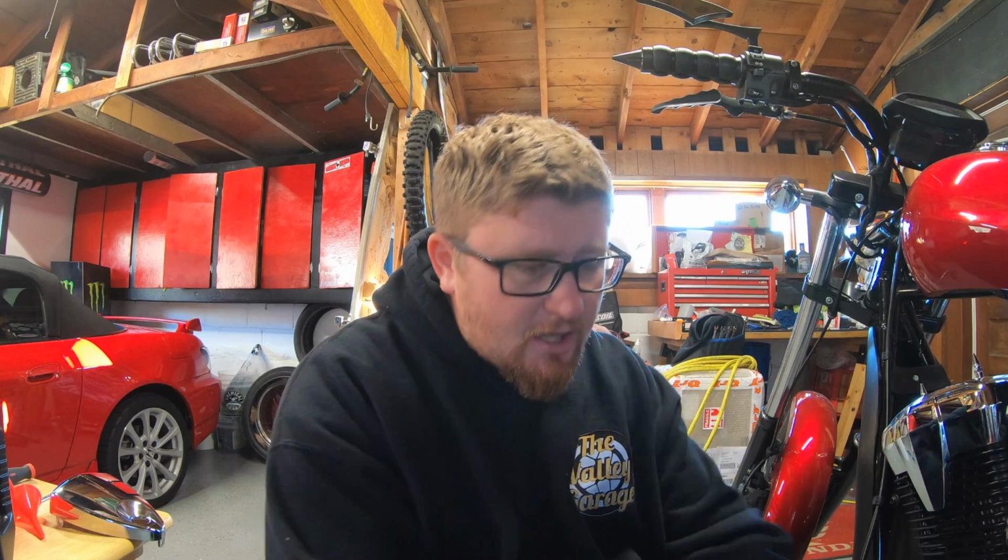After you do the coolant change, you go for a couple rides here or there. Take a look at the back of the fill line. You don't have to take everything all apart, just take a flashlight and look. If it's a little low, it's so easy. You take your remaining coolant and you top off the little reservoir there, keep it around that full mark, and you're good to go. I'm gonna go ahead and just button her back up.